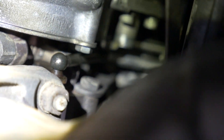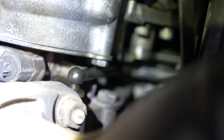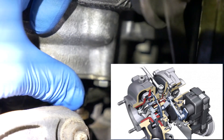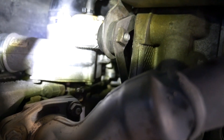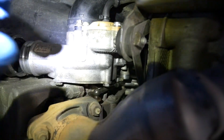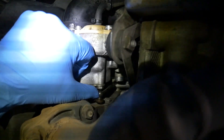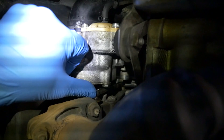I have the VRV replaced on the passenger side as well. Another thing to check is the variable geometry turbo VTG linkage — make sure it moves freely. You can see me moving it up and down here. You'll want to lubricate the linkage down here and up top, and make sure it's not corroded or frozen. Check both sides — on the passenger side it pushes up, driver's side you pull down. You can see the actuator rotating, and this side is fine.